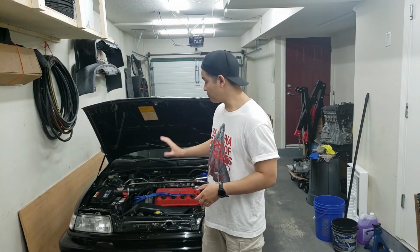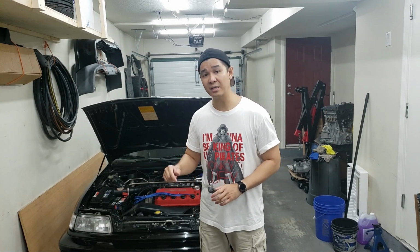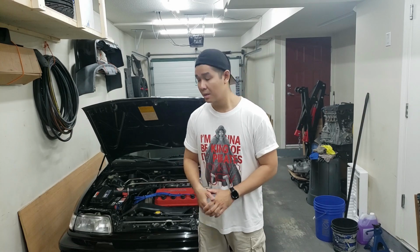Now, another couple common symptoms that you may experience is that if your engine's off and you're listening to the radio, say you're parked in a parking lot, if within 15 minutes to half an hour your battery goes dead because of listening to the radio, the battery is actually not holding charge. It's just not good anymore. Another thing is that if you're cranking the vehicle and you notice that it is cranking a little bit slower, that's another symptom, because a strong, good battery that holds 100% charge will crank no problem. It will be a very strong starter crank. I'm experiencing both of those symptoms, so those are 2 very, very common symptoms.